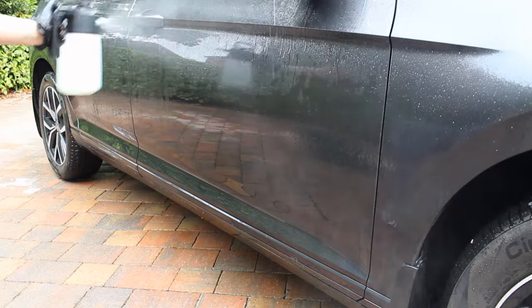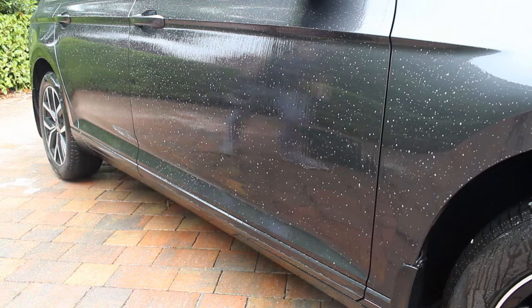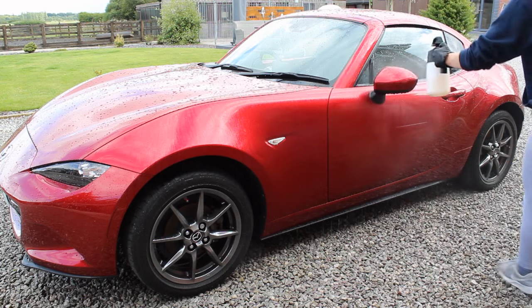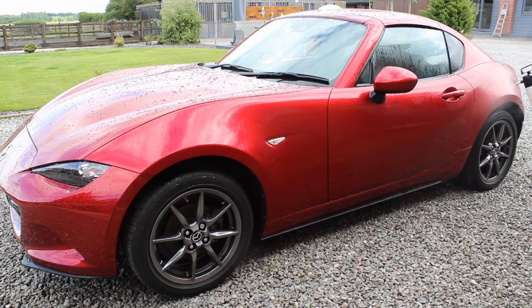In terms of how much product is dispensed, I've found around 400ml per minute at decent pressure — not letting it completely die out. To fully dispense a litre takes around two and a half to three minutes depending on how often you pump it up. In practical terms when washing a car, I use around 800ml to a litre for a medium-sized car. Starting with 15 pumps, I get 30 seconds of good pressure, then pumping seven or eight times every 30 seconds gives around two and a half to three minutes of working time — more than enough to cover the entire car.